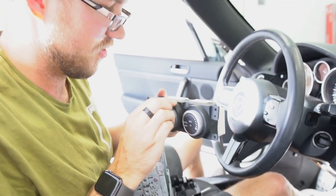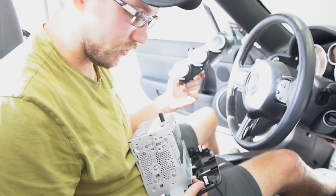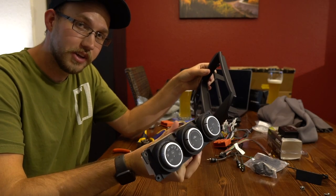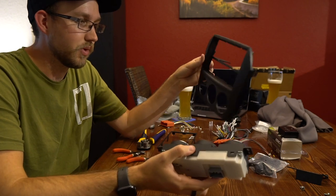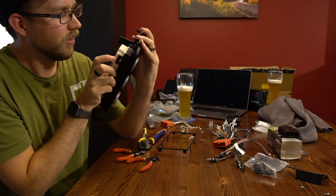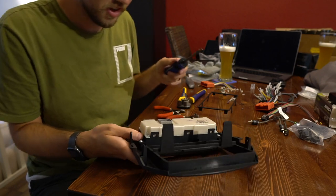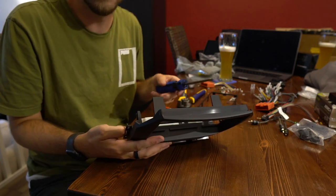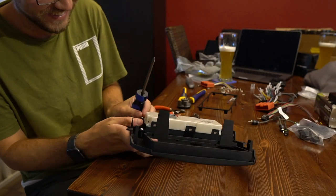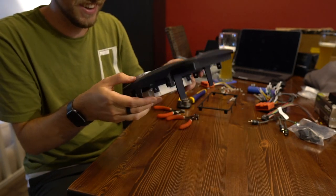These brackets go into your new Metra dash kit, and the old head unit is trash unless someone wants to buy a used Bose head unit. We got the HVAC controls out of the old head unit we just pulled from the car. We have our new dash kit made by Metra and we just need to screw the HVAC panel into it. There are a couple of guide markers for the screws. I think I heard the NC1s don't have that little peg, so people have installed those upside down. Looks OEM-ish.